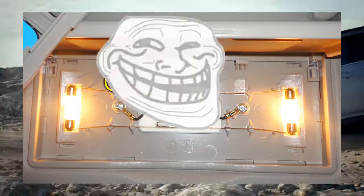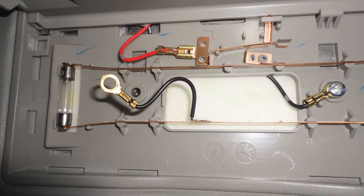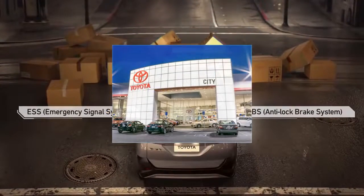Alright, first loosen the bottom part of the mirror panel with a knife. If you are confident in your knife, also use it as a lever to pop out the panel. Otherwise, switch to the flat head of the screwdriver. Be careful because you don't want to chip the plastic. Now, the reveal. Take note of this component because it's the one causing trouble. Next, you can simply unscrew any of the two. I chose the left one simply because I can clearly see where it's leading to. By the way, I think this screw itself is connected to the main negative line. Anyway, secure this loose wire underneath the copper bar to prevent it from touching other components. Then again, follow protocol by visiting your dealer.